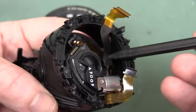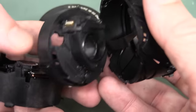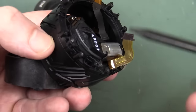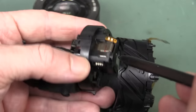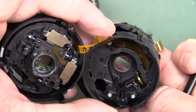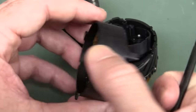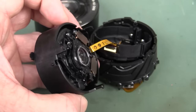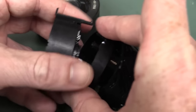This is why this flat flex has to be bent — because it's compliant, so when the lens zooms in and out it's got to feed off to the motor down in here. There's a motor at the top which drives the whole lot. Looks like there's a second one down in there... and there's definitely a third motor over on that side there. Wow. Complicator beast. Unbelievable. Multi-stage mechanism. How do you design this?